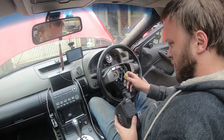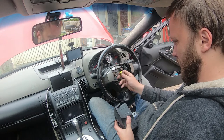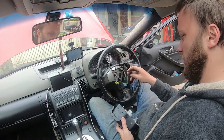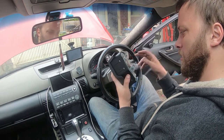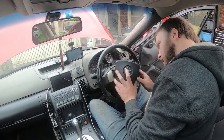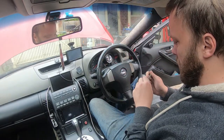Connect the airbag right up now. Some — I don't know if all cars have these exact same plugs or if it's just M35s — but these are easy to break. I've already broken one in the white Stagea, which luckily I got a replacement from Osaka Imports where I mainly get all my parts for these cars. Try not to break these because you're pretty much up for another clock spring if you do. So you just plug it back in, and put your security screws back in.